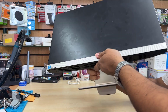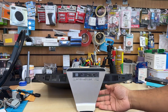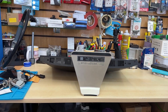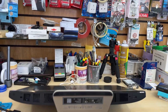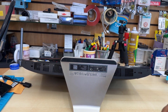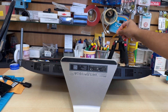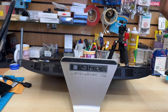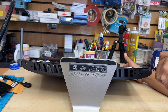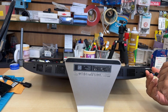So to open it, make sure you clean the surface — a flat table. Then we're going to take out four screws, and you need a Phillips screwdriver. By the way, the common mistake that happens is sometimes when you try to open it, if any dirt, nuts, or anything goes under the LCD when you put it flat upside down, it might break it. So make sure everything's clear on the surface.